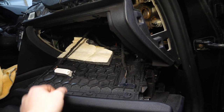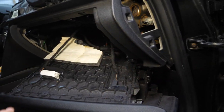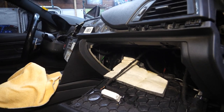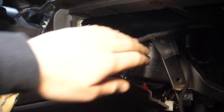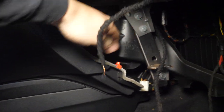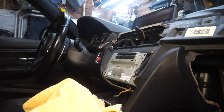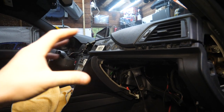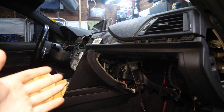I don't want tension on these wires, so we're going to disconnect them and pull out the glove box for full access behind the dash. With the glove box removed, you can now see the little cavity where we're going to put our MMI — it should fit quite nicely. You can now pull out the head unit, start disconnecting wires, and start connecting all those wiring harnesses included with the MMI.